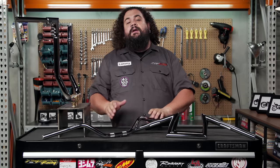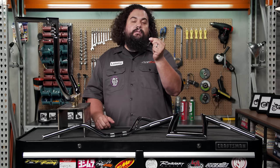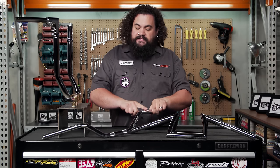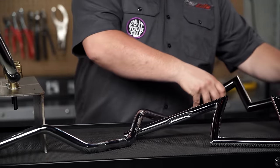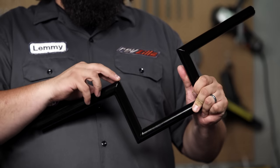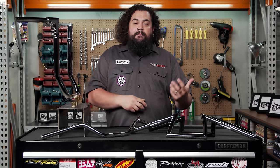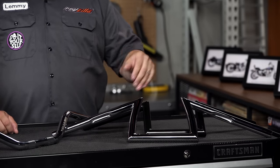If you plan on internally wiring your handlebars, it's a little fiddly and can be kind of a pain. Here's a quick tip: grab one of these — go find your local guitarist, grab strings from them, they always have old strings to throw away. These make great fishing tools if you're trying to internally wire some bars. Another tip: if you are internally wiring bars, try and use a bar that's designed like this one — a bent bar. Notice that every time the contour changes, it's a nice soft bend put through a tubing bender. These other bars have hard corners because of a weld — this is called a mitered bar. They make the bend by welding two pieces at an angle, and those corners can be really difficult to internally wire. If you're set on internally wired bars, go with a bent bar rather than a mitered style. They get particularly bad when angles in the bar are acute — less than 90 degrees.